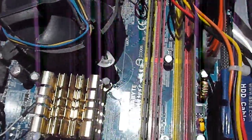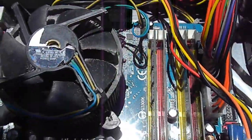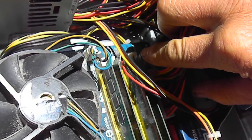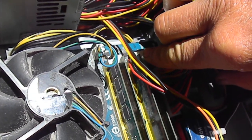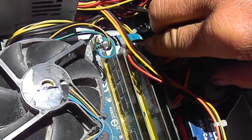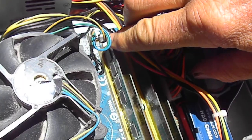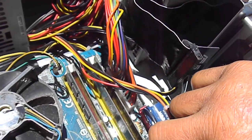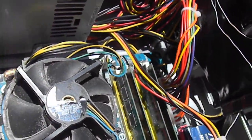It's possible that when they stuck the vacuum nose down in here, they may have jarred loose some of the RAM. So that'll be one of the first things I do is check the RAM. That RAM stick was loose. I'll take them out and fill them in one by one and fire it up, see if it comes on.